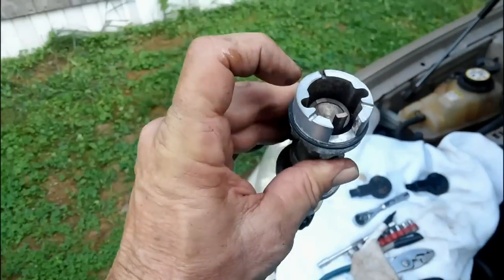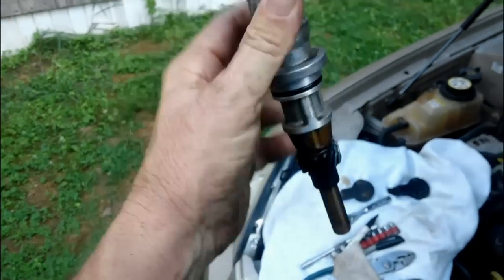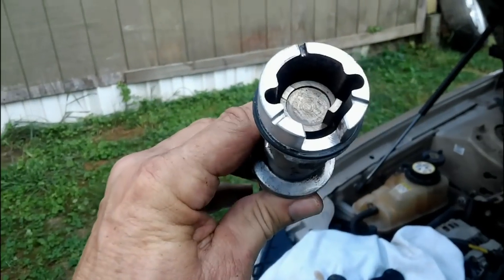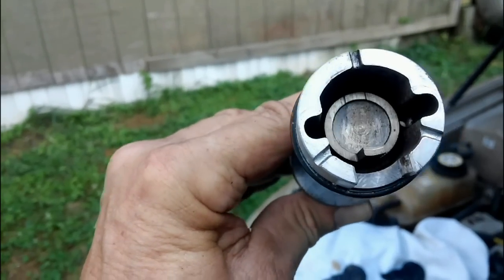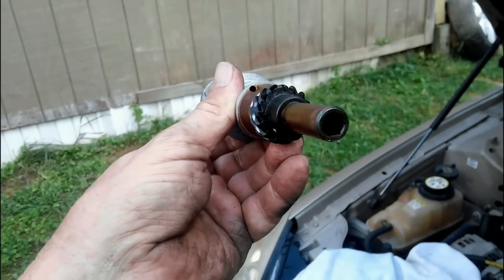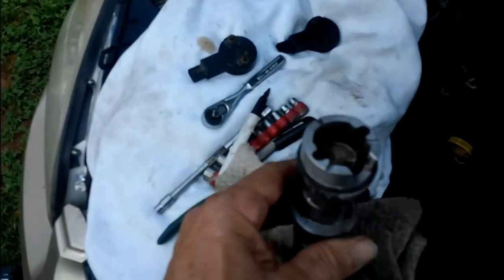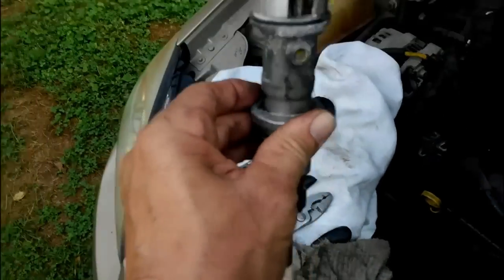Take that bolt off and this whole unit will come off. They do make a little plastic knob — a cam tool that you can buy and stick on there. Because when you go to stick this down in there, you have to actually back it off just a little bit. When you stick this down in, this gear will move — when you slide it down like that, it'll kind of move. So you have to play around with it a few minutes before you get it in there. The bottom of this actually goes down on the oil pump — it rides off the cam gear, and this is what actually operates your oil pump.